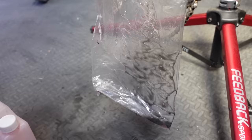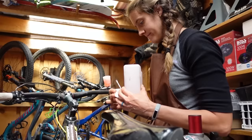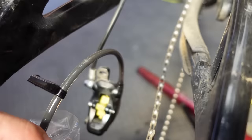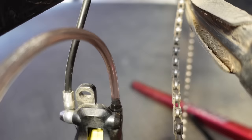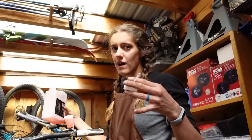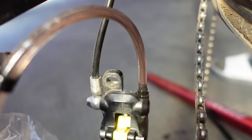Syd is up at the lever making sure she never runs out of fluid, because if you let it run out you start sucking air into the system. What we're going to do is watch down at the caliper until the fluid coming out stops being black — we want it to be pink, which is the color it's supposed to be. We're getting pretty clean now but can still see some black, so we'll let it go a little longer because if you're going to do this, you might as well do it properly. When doing the rear brake, be even more careful watching the fluid level because that line takes a lot of fluid. For the front brake, it's pretty much going to be about a cup of fluid.